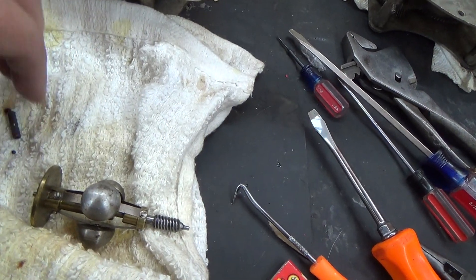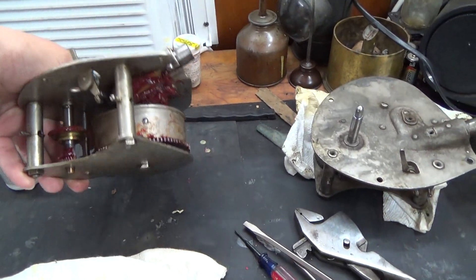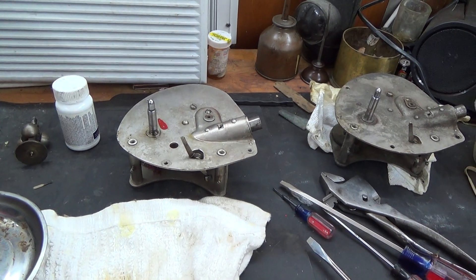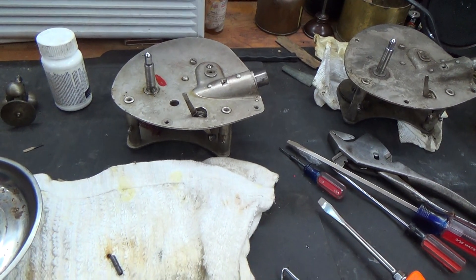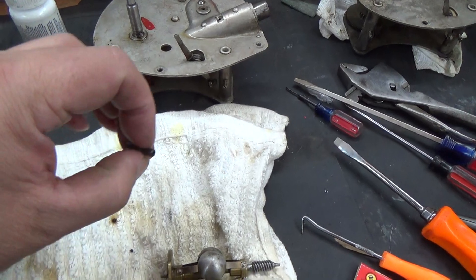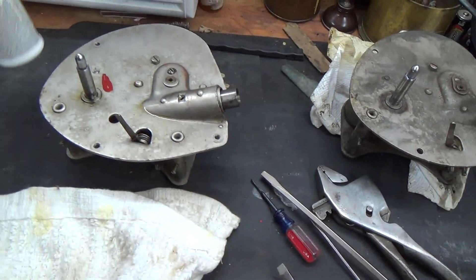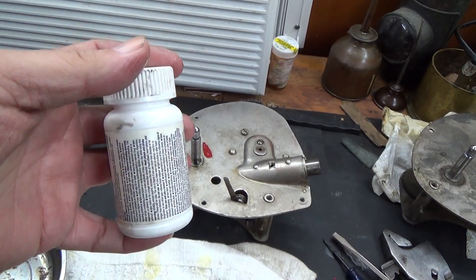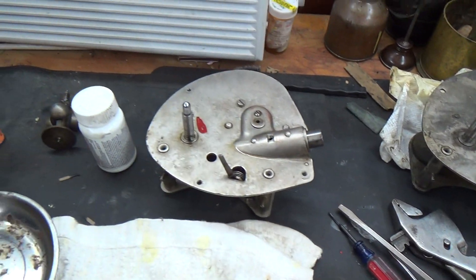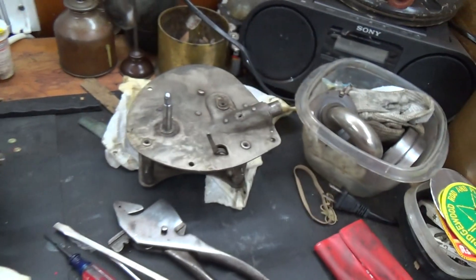What happened here with this HMV 102 — the 270D motor — was that it had not been lubricated in a very, very long time. The bearings were seized inside. They were rusted into the bearing caps, not just glued with old lubricant. I tried everything. Usually I put these caps into a plastic pill jar with some heavy-duty solvent — in this case white gas — agitate it, let it sit for days. For old lubricant that will dissolve it and they'll come out. Not with this motor.